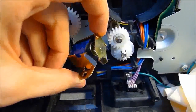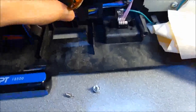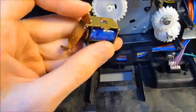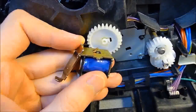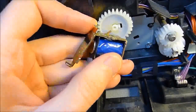That's what it looks like with my little gray piece of electrical tape stuck on there. Now you can go ahead and put the spring and the screw back into the solenoid and hook it back in. Just be very careful when putting the spring back on — I would suggest doing it from this angle here, otherwise that spring is going to act like a rubber band and shoot off into far corners of your office, which has already happened to me twice. So just be careful when hooking that back on.